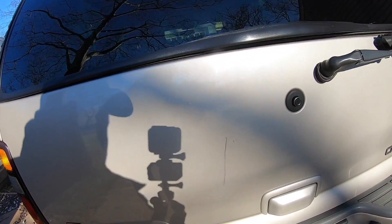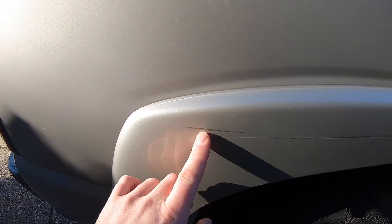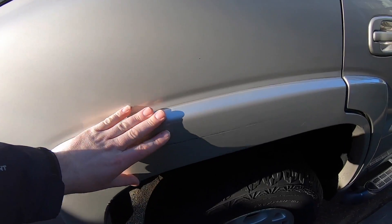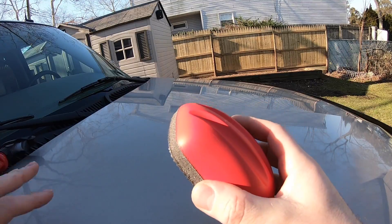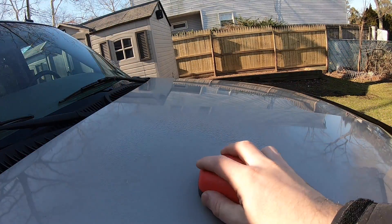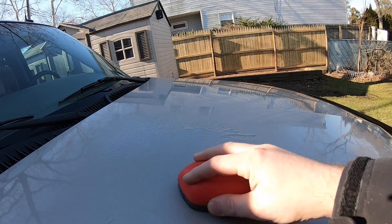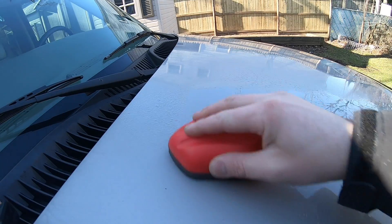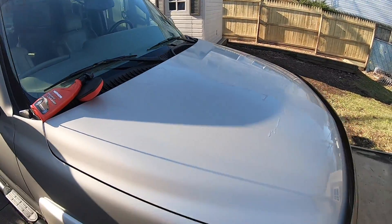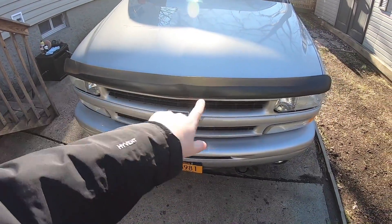Before we get started, I'm going to take a quick walk around the truck. You can see back here we have this big scuff I'm going to be focusing on, as well as a scratch going along here. This actually looks deeper than I thought — the black is probably going to come out but down here it gets a little white. I'm not sure if this is dug into the paint or if this is plastic or metal. I think this flare here is plastic. Now I've got the synthetic clay bar out — this red part I thought was plastic but it's actually a thick foam. All you do is spray down the surface, spray down the clay bar, and rub it along the surface. It'll feel rough at first but as you go along it gets smoother and smoother. I'm going to pull off this bug guard slash unibrow too because I need to get in by the edge of the hood with the buffer. I'll break out the time lapse and get the whole truck clay barred.